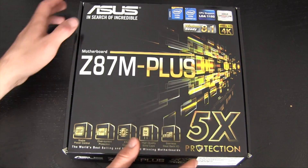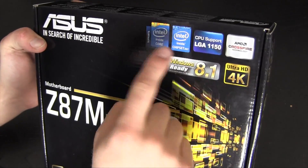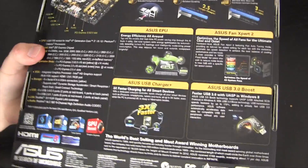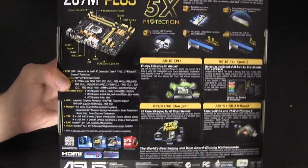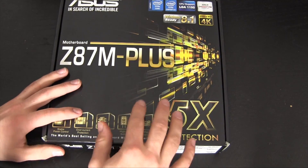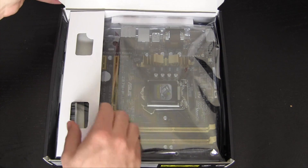Here's a really quick glance around the box — you can see Intel badges for Core i3, i5, and i7. This is an LGA 1150 Haswell motherboard. It's a very basic, entry-level board, and once again it theoretically can run OS X just fine if that's your endgame, however that will not be the focus for this build. So opening the box, the first thing we see is the motherboard — very Apple-esque. This is a micro ATX form factor, so it's not mini ITX or full ATX.